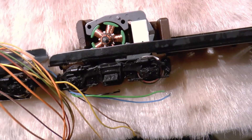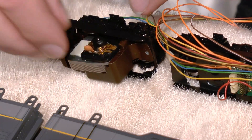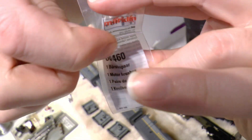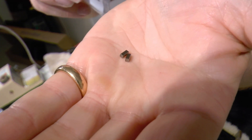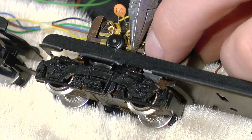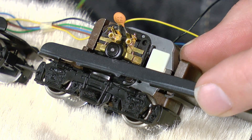I insert the magnet with the rotor installed and then put the motor shield on top. Make sure everything pops into the right position — it can be a bit tricky. Once that's ready, it's time to assemble the motor brushes. The motor brushes are put into their pockets. Make sure to place them the correct way, and put the spring in place which presses them towards the rotor.